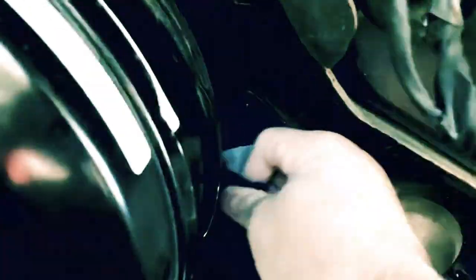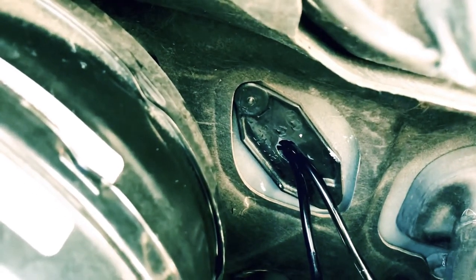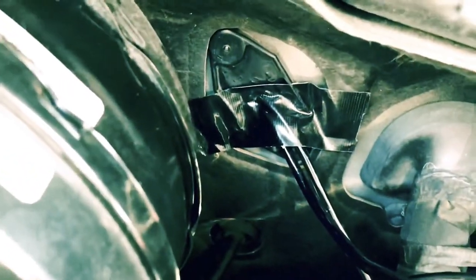If you look in here, I have duct tape covering it, but there's a little panel underneath. There's a little panel right there that exposes you to your firewall on the Ram 1500 — it's nothing more than a soft piece of rubber that you can drill through. I drilled a small hole designed for wires just like this. It's actually the proper location according to Ram for drilling through firewalls. It comes in right behind the firewall underneath your steering wheel behind the pedals — very user-friendly. I put tape on it because it makes me feel better knowing the hole's covered, in case any liquid could possibly get in. And I can't say enough good things about this Gorilla duct tape — this stuff is awesome.